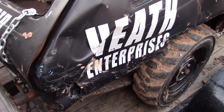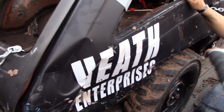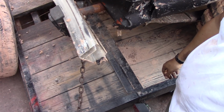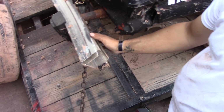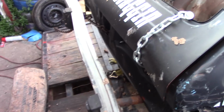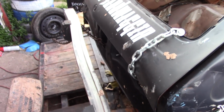Everybody came up into the pits wanting to know about this. Even the inspectors. Boy, this is a really clean car. It is. Kinda. So, the aluminum bumper. I made a couple back end hits. This is the only thing that went wrong. If you get a good look through here, we actually stamped it through the outside aluminum on this side. But other than that, it bent. It didn't break. It bent the steel mounting plate, but the bumper is good. Nothing moved. I'm happy with those.